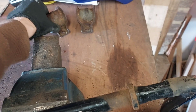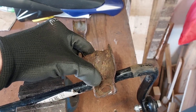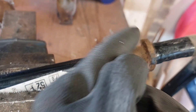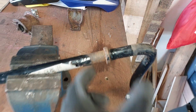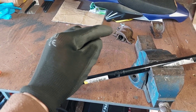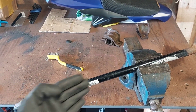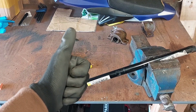These little clips are almost what stop the anti-roll bar from slipping, keeping it in the exact place on a Ford Focus. Obviously I need it to slip in about this far. It's no big deal because once it's bolted, it's not going anywhere. I was hoping they'd just be spot-welded on but they're not. If I have to, I'll just cut it off in chunks and grind it smooth, then I can move the anti-roll bar bush in about 10mm each side and it should bolt up. There are also a couple of tiny bits to trim on the actual car — a little bolt slightly in the way and a tiny bit of exhaust hanger — which is part of what took so long.